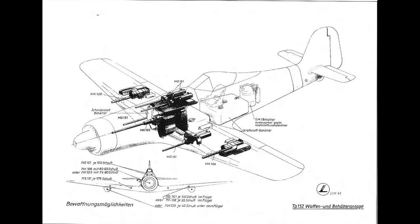An oxygen tank doesn't hold all that much. Think of how big the tanks are that supply one individual breathing, either a scuba tank, a bottle of medical oxygen, aviation oxygen, whatever. A 2,000 horsepower engine would deplete such a tank in seconds. The required storage tank size for an engine boosted with pure oxygen would be too large.